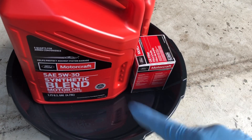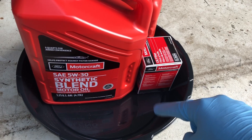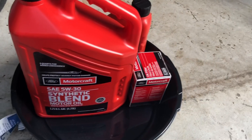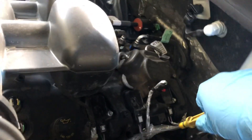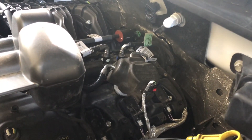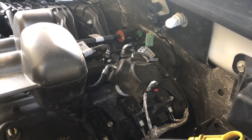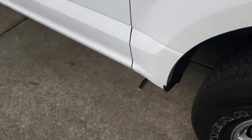So right now you need 6 quarts of oil, your oil filter, and a drain pan — this is a 7-quart pan. We're probably not going to get a full 6 quarts out, as some oil always burns off. You're also going to need a towel to wipe off your dipstick. There's the dipstick. The 3.3 liter is much smaller than the 3.5 and 3.7 which it replaced, including the 3.5 naturally aspirated from a couple years ago. So pull the dipstick out.